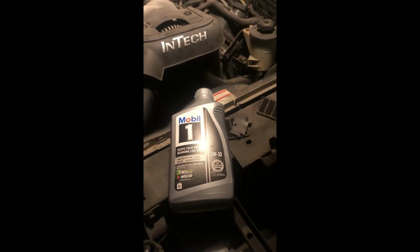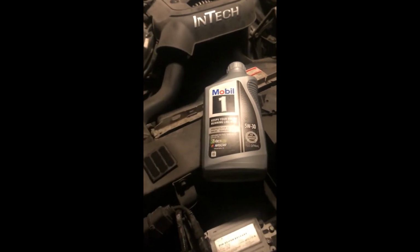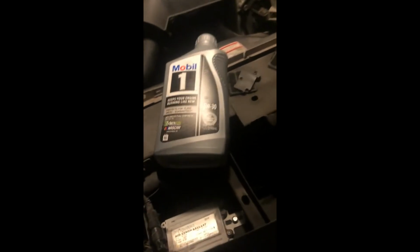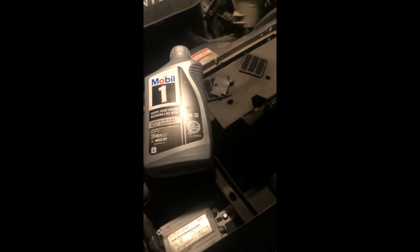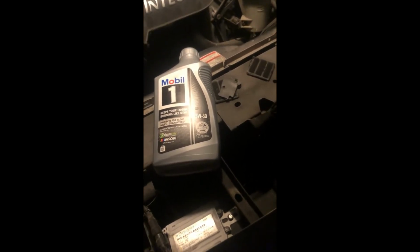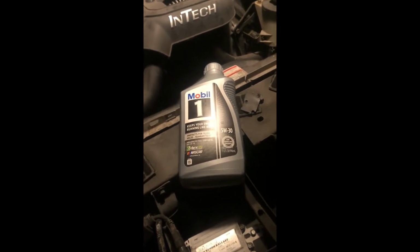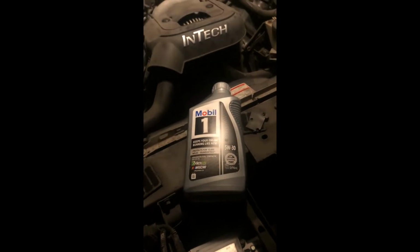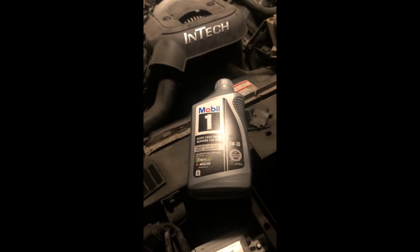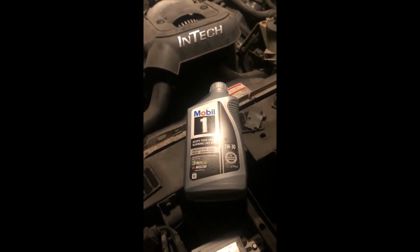If eventually I get enough subscribers, yeah, I wouldn't mind an oil sponsorship. But here's the thing. This stuff also claims that it's good for 10,000 miles guaranteed. That might be true. I'm not here to dispute that. But what I do know is oil is cheap. Rebuilds are costly. I try to do 75% of what the oil minder says. It's a little thing on the dash that says oil change in such time. I try to change it at 5,000 miles or whenever it says 25% life remaining, whichever comes first. This one I'm a little late on.